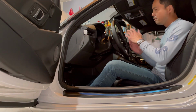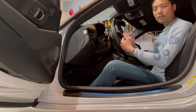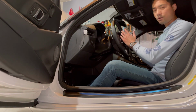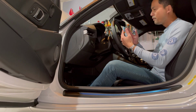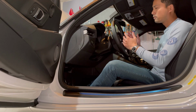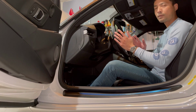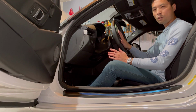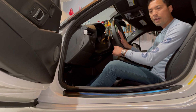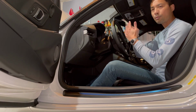So with your flathead, you're going to start on the left side. I showed you guys where to insert your flathead, and what it looks like on the inside of your airbag, so we've already established that. The critical thing that I didn't point out is, you start on the left side of your steering wheel. You compress all the way in your airbag. You press it in, and you're going to feel something give, and that's your spring giving.